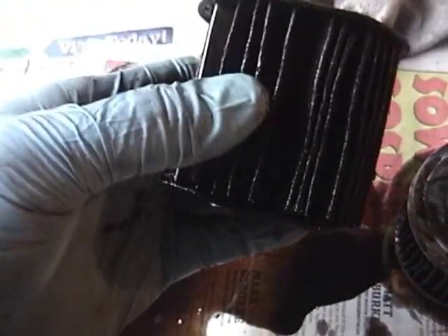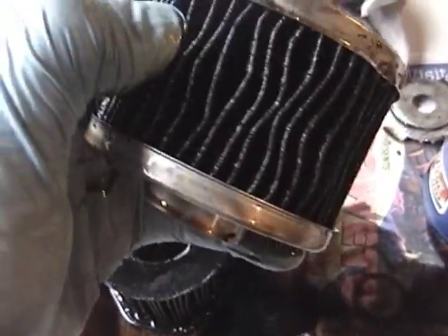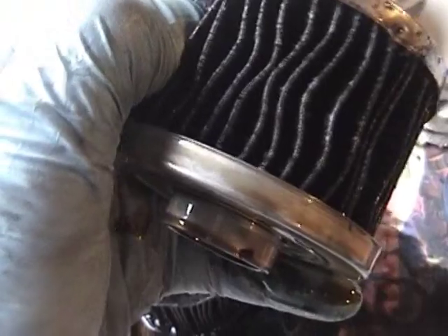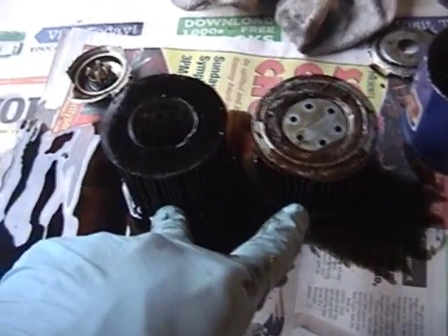This filter has been soaked in oil for about two or three months in my car for 5,000 miles — probably two months — and then another two months here in the garage. I'm pressing on it pretty hard, and I'm hearing a little bit of a tearing right now, but I'm really wrenching on it with my hand. The fins themselves don't seem to be coming apart. Getting a similar sort of thing here with the STP, actually — putting similar finger pressure on it, and this is also tearing quite a bit more easily. I think these are both cardboard elements. I'm pretty confident this is roughly the same kind of cardboard element in each one.